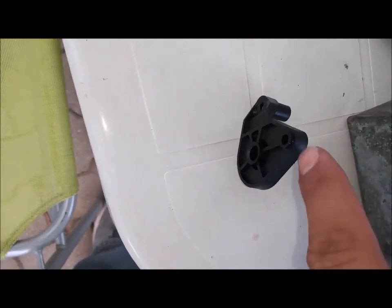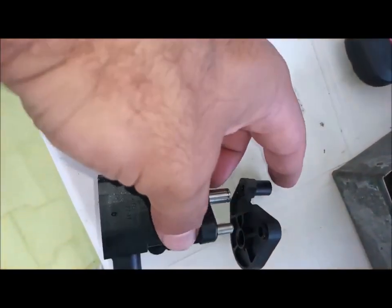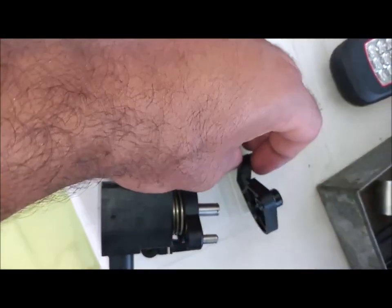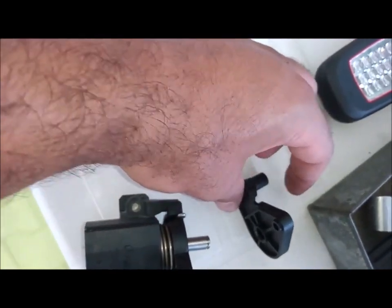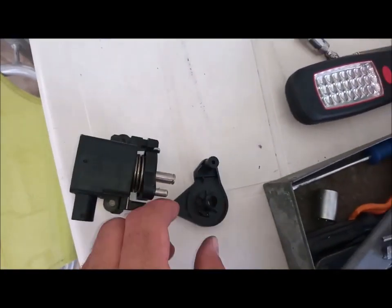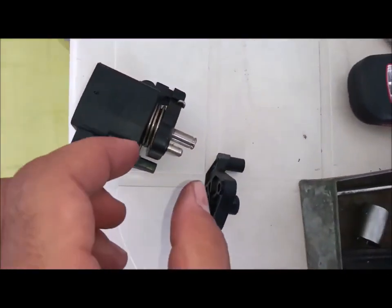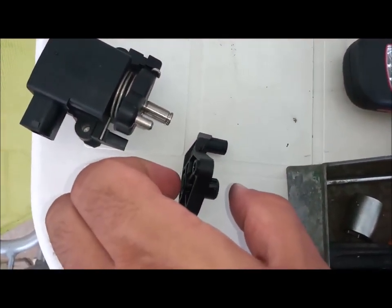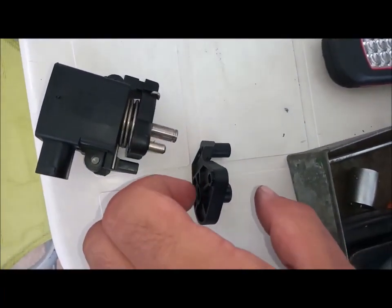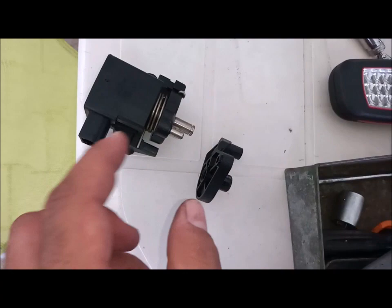You can see here it goes through this piece — there's the spring with the lithium grease and the pedal hook. If you find any difficulty putting it through, try to maneuver this while you are pushing. Try to level this one. When you take the old one out, make sure you hold this piece with this plate — hold them together so it doesn't flip out and the spring doesn't come out. Putting that spring back on is a big headache. So once dismantling this pedal sensor, hold this as one piece and retract the sensor out while holding it in its place. You shouldn't move this piece at all.